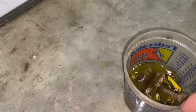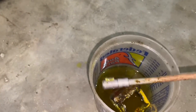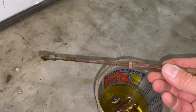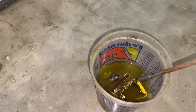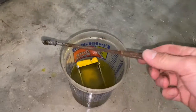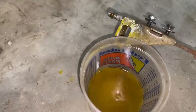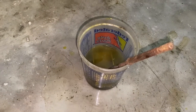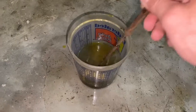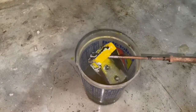I don't know if it's worth noting or not, but something seems to be happening. Wow, it cleaned up that pretty good! This is a piece of throttle linkage from a 1960 Pontiac Ventura. Let's keep it dipped and see what it looks like in maybe five or ten more minutes. Well well well, look what we have here — this is totally working! Oh, got it on my phone. If you get muriatic acid on your fingers it stings, but secondly — this is totally working. It's taking the rust off!